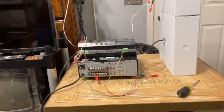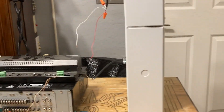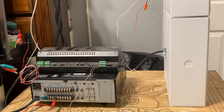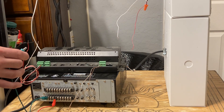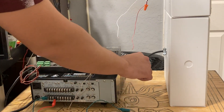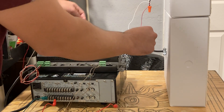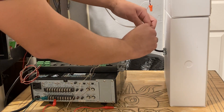Let me line this up so you can see what's going on — this is important. We're going to start with the easy step. I have five watts, two watts, and one watt in our imaginary case — you tap it accordingly on the transformer using the common and whatever respective positive tap terminal you have; it varies by manufacturer. So let's wire the speakers together — we're going to gather all the blacks, which is the common, and this is the 70-volt coming out of the amplifier.